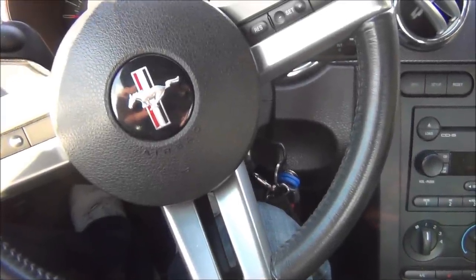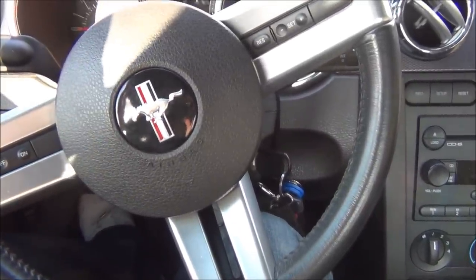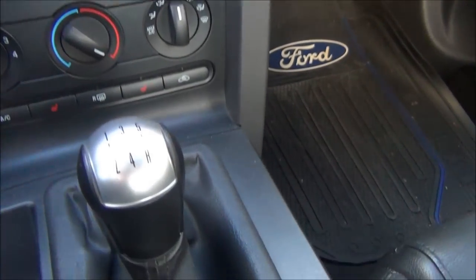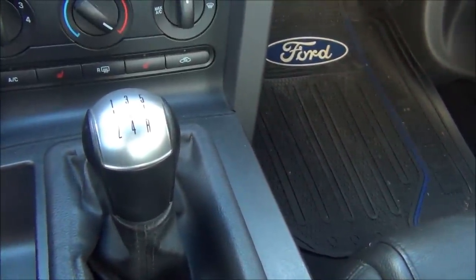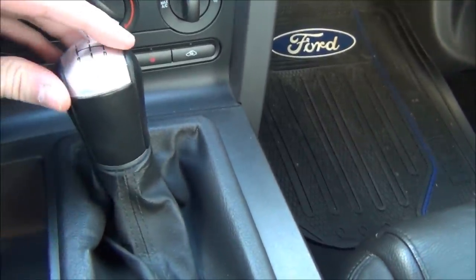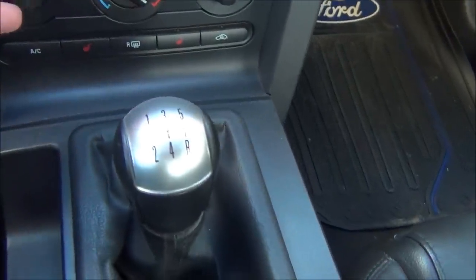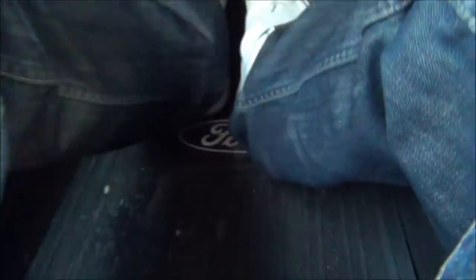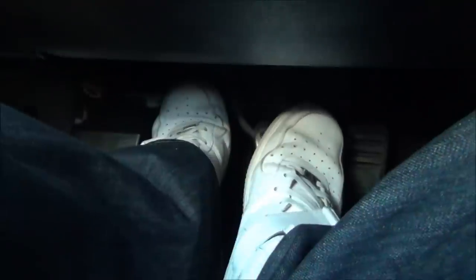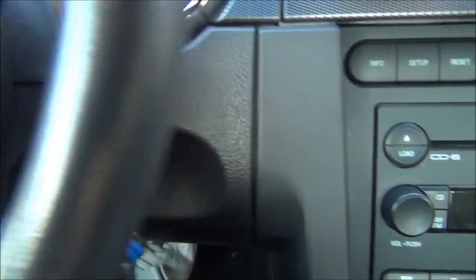Most importantly, let's learn how to start our car. It's not like an automatic where you just put your foot on the brake and start — it's a little more involved. Right now I have it in neutral, and you can tell because I can wiggle it left and right — it's not caught in the gate of a gear. In neutral, in order to start the car you have to have your foot on the clutch. This foot is on the brake so I don't roll, and this foot depresses the clutch all the way in until the back of the clutch is at the floor plate, then you come over to your ignition and start it.